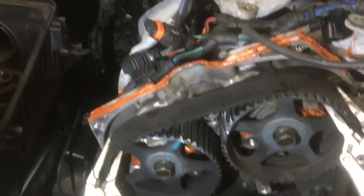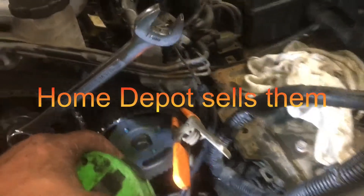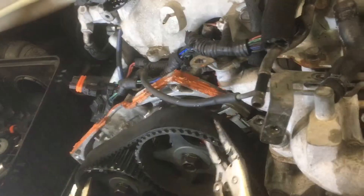So you got that. You put all that on. You see I got some clamps here. This is a test belt — if you have a bunch of these you'll do great. Home Depot sells them. You can put them on; they hold the belt in place. Right now I'm kind of holding it in place. But like I said, this is my test belt, this is the old belt. It skipped a little time and we're just here to see if we can rescue this motor, because as you know this is an interference motor.